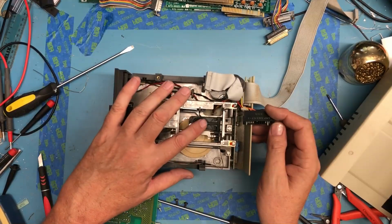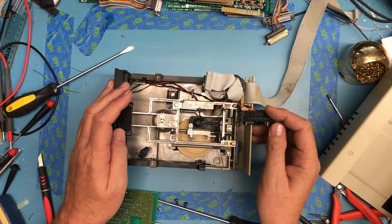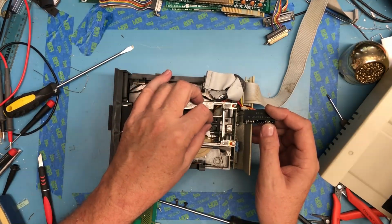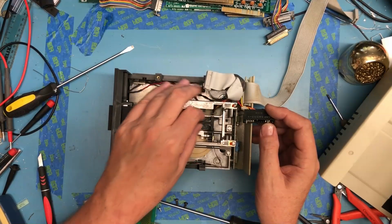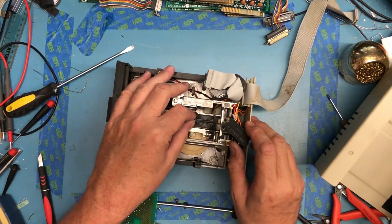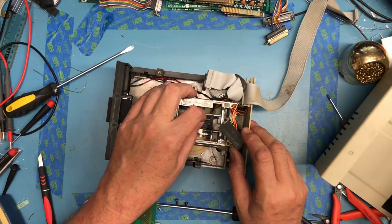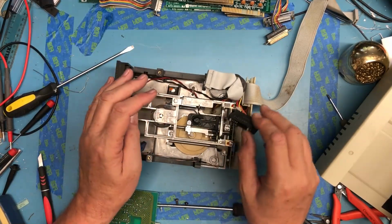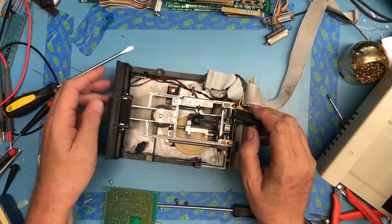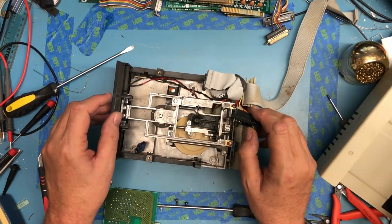Having read up on Apple floppy and how this was all put together, there's no sector hole reader here, and no micro switch or whatever to say we're at track 0. Although it's interesting, there are little brackets there to break the opto that we're at track 0, but it's not there. The controller simply sends 35 or 40 step outs before trying to read the drive, those kind of things. I find all that interesting, how minimal this really is.